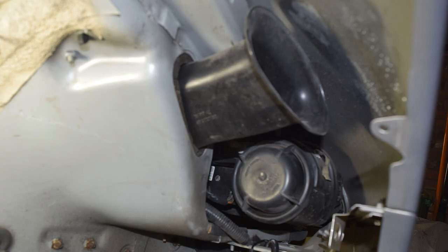The reason I believe the right-side lamp may run cooler is that the car's air intake snorkel is on that side. The wheel arch liner is removed but there are plenty of gaps around the outside, including one between the headlight and the hood, that allow air into the area. This may mean that lamp gets cooled a little more — not that it wouldn't eventually fail anyway, but it would be generally operating cooler.